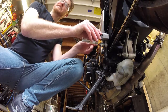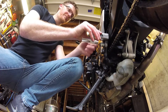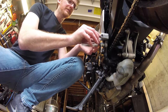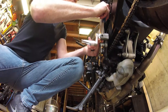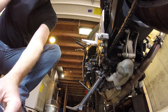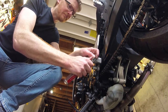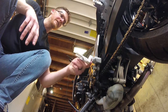The issue is the distance as you put these on — it's the distance between your foot and your shifter. If I put it back too far, I may find that I'm reaching and might have to cut and shorten my shift lever. I'd like to avoid that if I can. That fits perfect. Absolutely perfect. There she goes — hey, that wasn't so bad, was it?